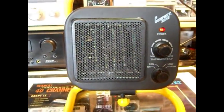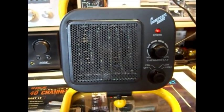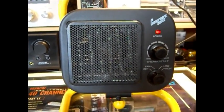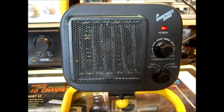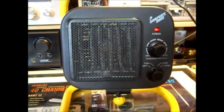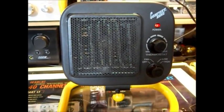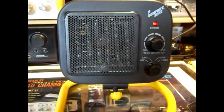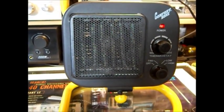Also, I ran the two fan motor wires around underneath the bracket. Because they had them running on either side of that bracket wall that was stretching them. I looked at it and set it back in there. When they assembled it, they just did a crappy job. I put the wires underneath that bracket, plus I put tape on them because it was stretching one of the wires. Well, with it sitting there vibrating and shaking, it was cutting into the wire. That would have shorted out, would have been the end of it.